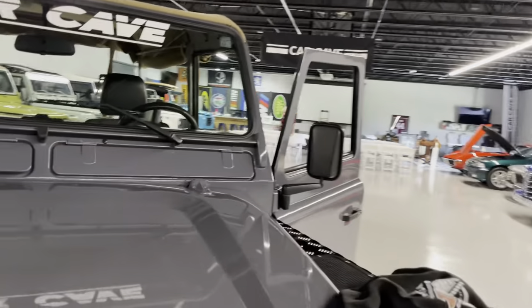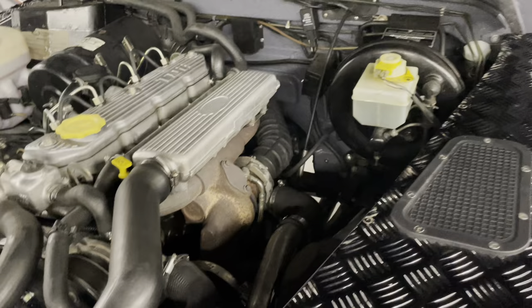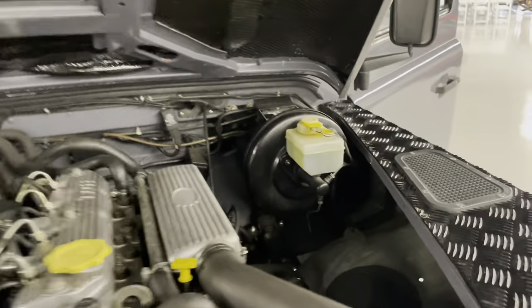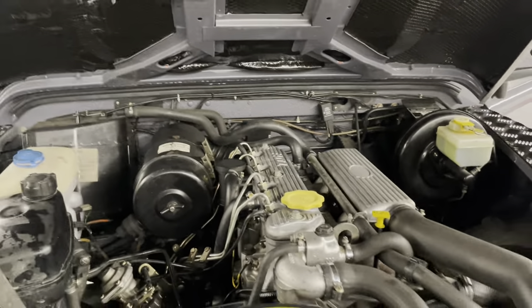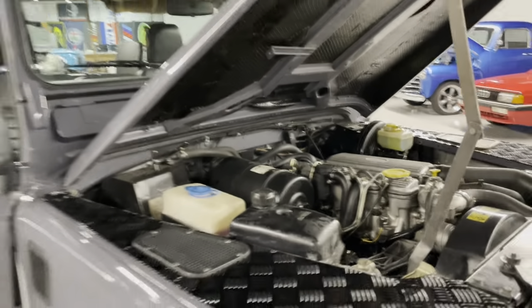You have checker plate up front and the KBX grill. It's a non-EGR model — you can see it's blanked off. Down here is also important: usually your master cylinders like to leak and you'll get rust there, but it's clean. The 300TDI runs well, it's intercooled. Overall we went through and serviced the little things it needed — it's all written up on our website.